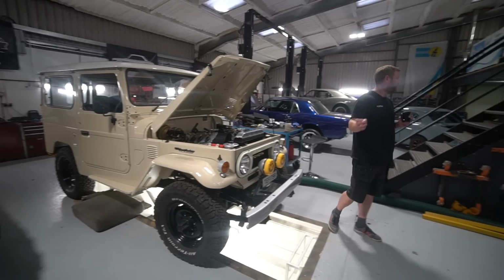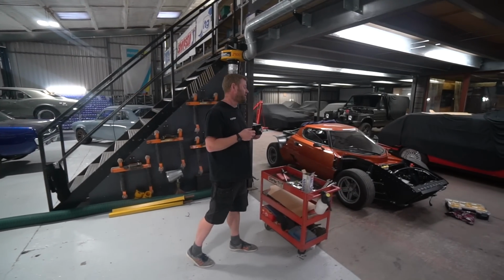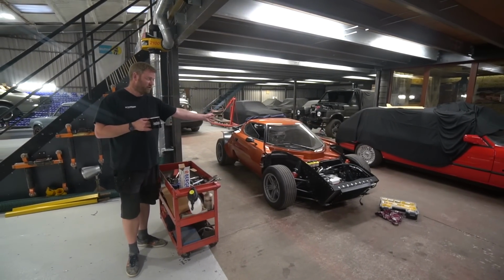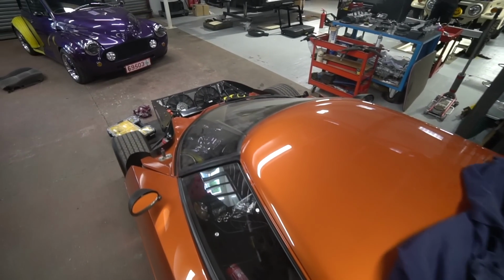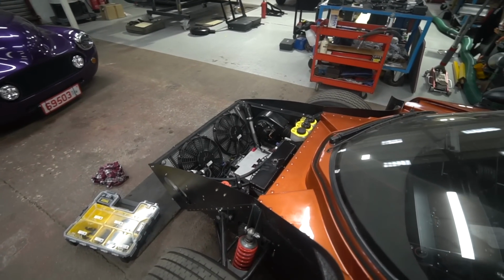And then I'll probably just briefly finish on the Stratos. Last week we mentioned we'd found a leak from the evaporator, or that's what I thought, because it was refrigerant coming out from the heater box area. So we've stripped that apart and had the evaporator out. There was indeed a pinhole on one of the pipes, if you like, that make up the matrix. Can't think of the correct word.